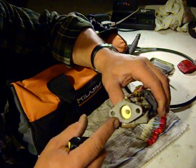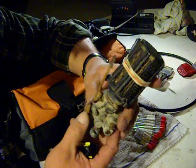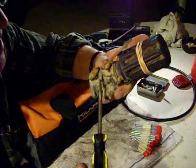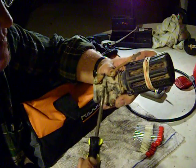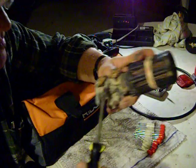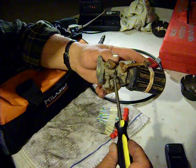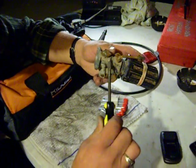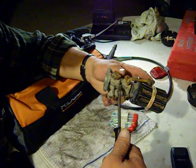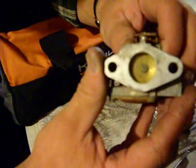Now, this would normally idle at one speed, but we're going to be making the fuel much more combustible. So what you're going to need to do is take this off until the throttle plate closes. It's one and a half turns — one and a half turns and it's closed. So I've got it down as close as it'll get, and this thing will run at a really good speed with the throttle plate almost completely closed. So I'm going to screw it back in one half, one full turn, and that's where I'm going to put the groove. If you look down in here, you can see the angle of the plate is still pretty steep.